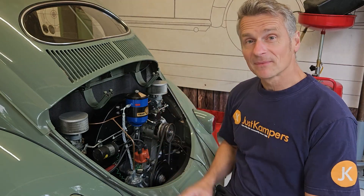That's the engine done — I ran it for around 20 minutes putting load on it through the brakes, then afterwards double-checked the ignition timing and reset it, balanced both carburetors, and reset the mixtures. Now we're ready to put the boot lid back on and take it for a run. On the test drive we're keeping it free-revving without overloading the engine, using a bit of an incline to help break those rings in. We want to put a little bit of load on, so going uphill with the throttle open allows the RPM to build, then change gears — same again without overloading it. That's the road test complete.